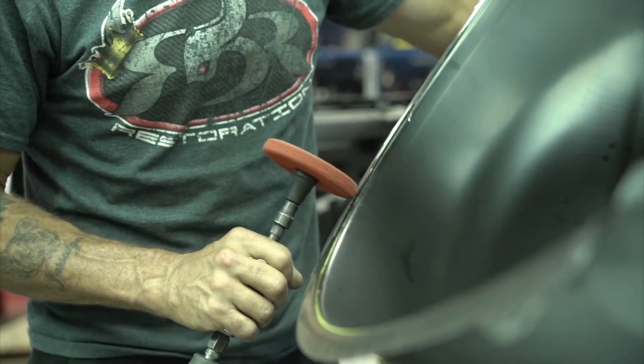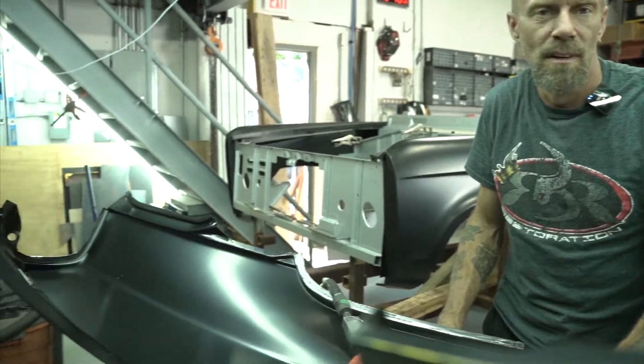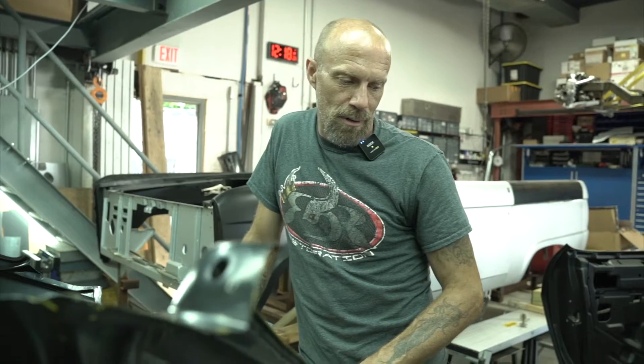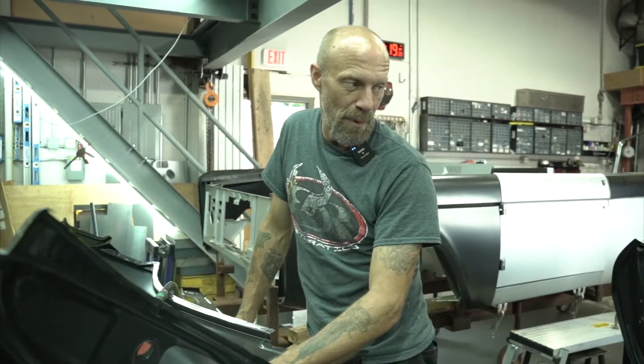Cleaning the quarter panel up and getting ready to put it on the car, hopefully getting it welded up soon. We're in the mid-stages — probably a couple more days and it should be out rolling. You line everything up as many times as you can to make sure it's right. There's always the initial mock-up: get everything lined up, take it back apart, clean it, prep it for welds, and get all the inner structures done before you weld. Basically all the full-build metal work happens here and we all work together to keep it going.